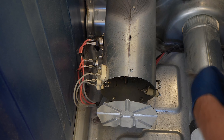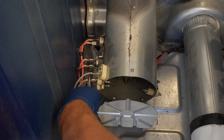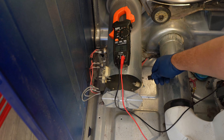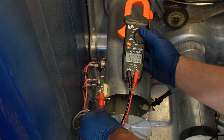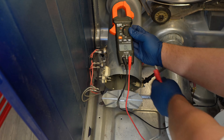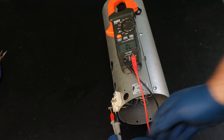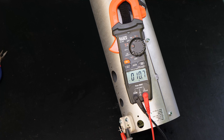Now let's get to the element itself. You need to remove all the connectors to the heat canister. Some of these units are going to have two wires on the left and others are going to have three on the left and one on the right like the one we have here. Testing them is similar. Set your multimeter to ohms resistance, then test each of the connections. The right side is from the motor and the left ones are from the sensors and heat system. You should get between 25 and 30 ohms of resistance between the right post and any of the three on the left. If you find that any of these connections show an OL symbol, the coil is bad and needs replaced. You can also test between the posts on the left side individually and you'd get 50 ohms of resistance. For a two-wire system, you simply need to check the posts with the same ohm test, but here you should get roughly 10 ohms of resistance. If you get an OL symbol, the unit is bad and needs replaced.